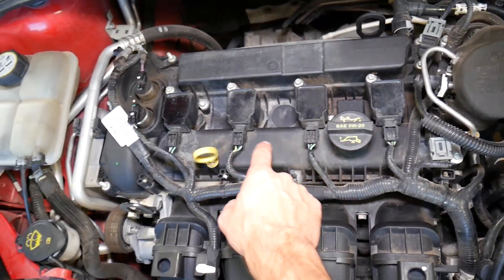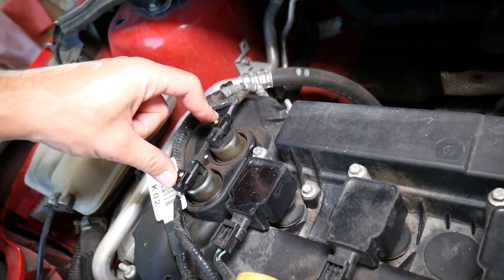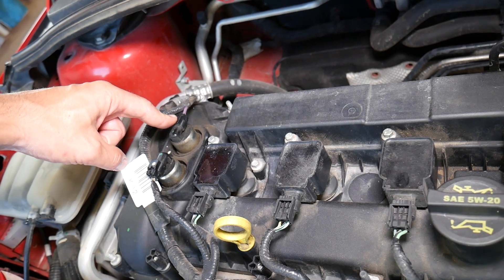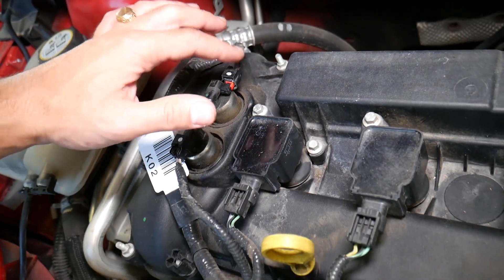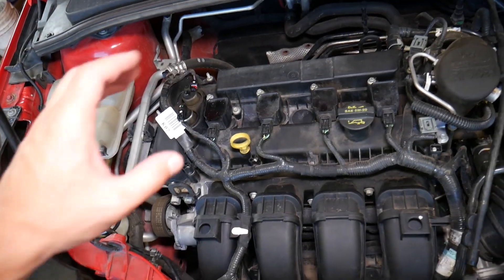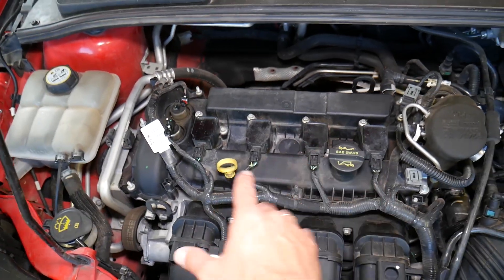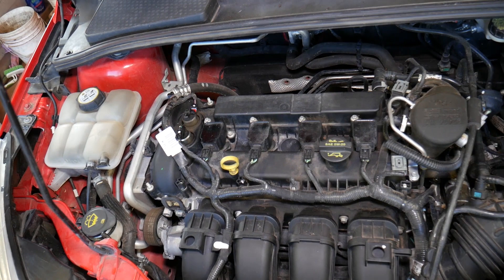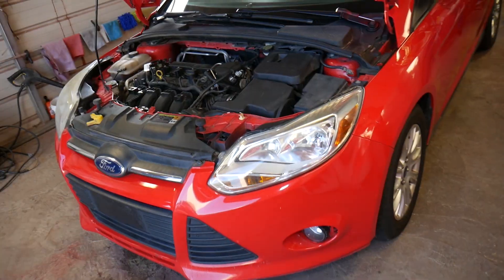We need to figure out which camshaft is intake and which is exhaust. In our case, this is the exhaust camshaft and this is the intake. You have two solenoids — two camshaft actuator solenoids. This one is for the exhaust side, known as Solenoid B; this one is Solenoid A on the intake side, and that's the one we have a problem with. To fix it, unhook the wiring harness — the link is in the description. You'll need to remove your ignition coils and the valve cover to access that solenoid, since it has one bolt on the inside. We have a full start-to-finish video on the channel showing how to do that.